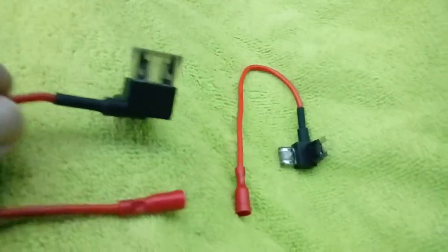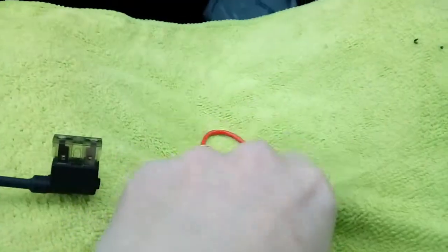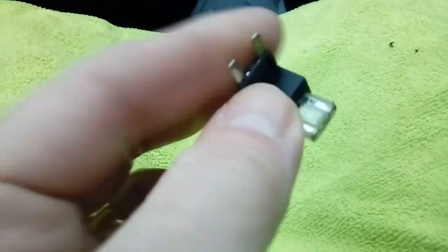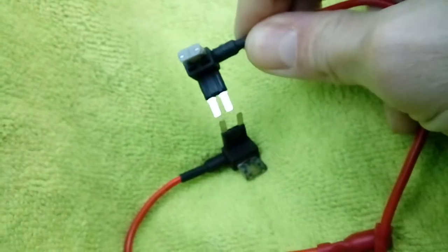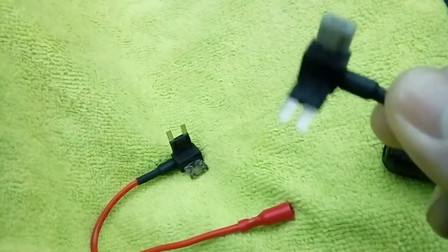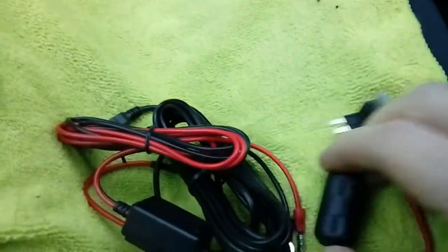One fuse spur is for the larger, generally older vehicles with a normal blade fuse, and also a mini blade which is much more common on newer cars. There are also a couple of variations — there are little micro blade ones, so if you need one of those make sure your kit supports it. The gap between the spades is much narrower — see how narrow that is compared to the others. Not many cars use these; some of the new Japanese cars etc., but you don't have to worry about that with your Dacia Sandero — you're more than likely going to be using the mini blade one.